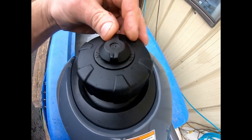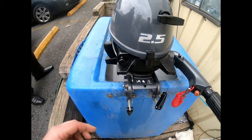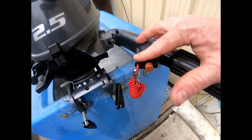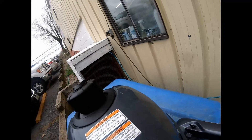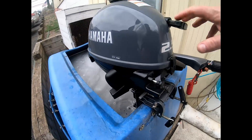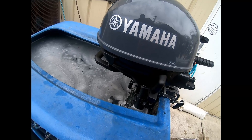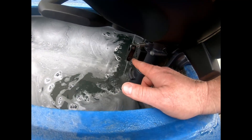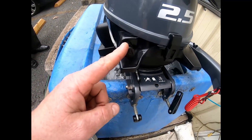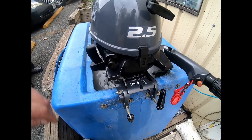Let's get ready to start this motor. First, make sure our vent is in the on position — flip that over to on. Make sure our fuel on the side is in the on position. Next, pull our choke out. Make sure our stop switch is on. Now raise the throttle so the choke sign is even with the indention, then pull. This engine was cold and I had to turn on the fuel so it took a couple of pulls, but normal operation is one pull. Make sure it's pumping water — the water comes out right below the middle of the bottom. Let it warm up; you may need to keep the choke out a bit longer if it's cold, but on a relatively warm day you can push the choke in almost immediately.